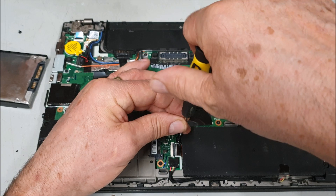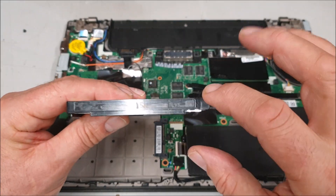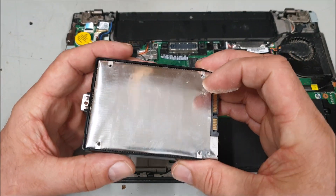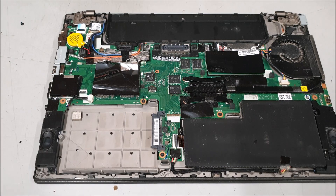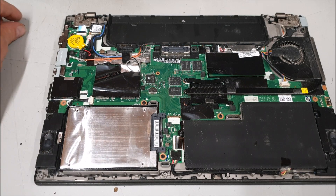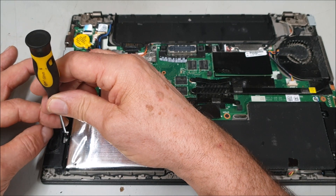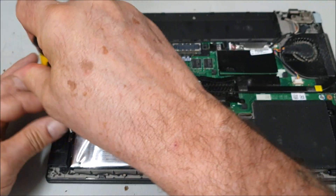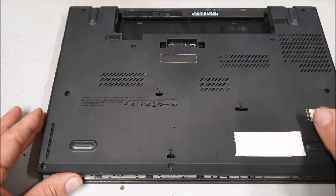Once you've got your new drive, it's pretty straightforward — make sure it lines up properly. You take off the outer casing from the old drive, making sure you know which way you took it off. The top of the hard drive faces downwards, so remember that. Fit the casing to your new hard drive exactly the same way, then gently pop it back in, line it up, push it home, and pop the screw back in. This is a very simple laptop to work on.